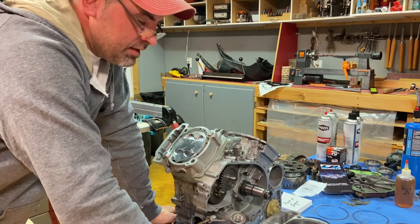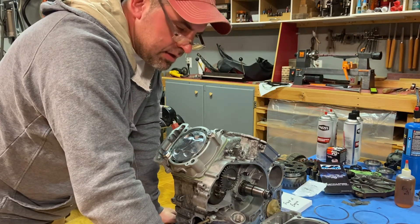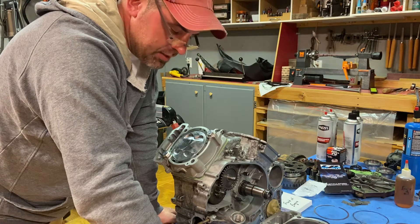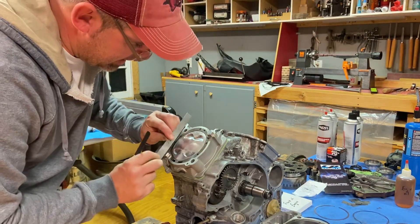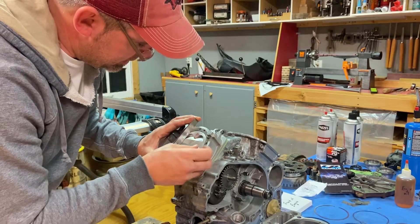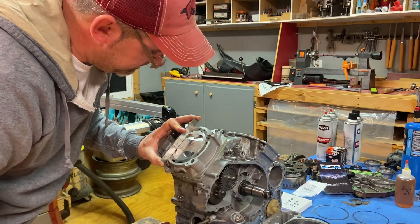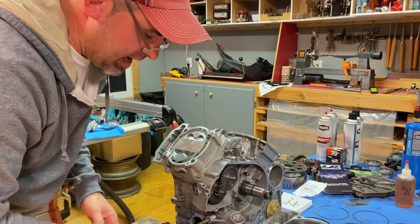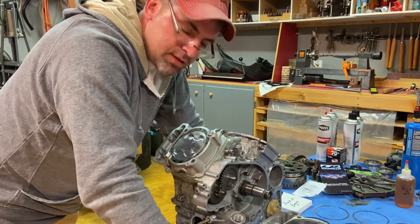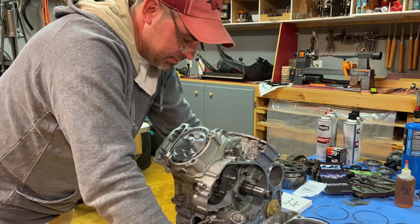I am running the Maverick race heads that are custom milled by Mr. RPM, and the Maverick race cams that they also mill — those aren't reground, they are one-off milled pieces. You're going to take your straight edge and lay it across the top of the jug, then take your feeler gauge and check that gap — which measured out just fine. Once you've done that you can pull your bolts, pull the jug back off, put your piston rings on, and then put the jug back on permanently.